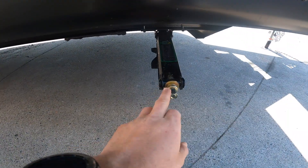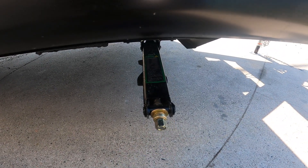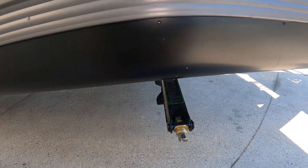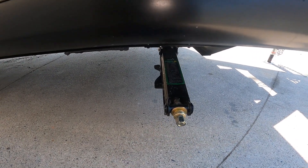On the topic of your stabilization jacks, we have one at each corner of the trailer. It's important to note that you should level the trailer fully before you engage the stabilization jacks. They should never be used to level your RV.